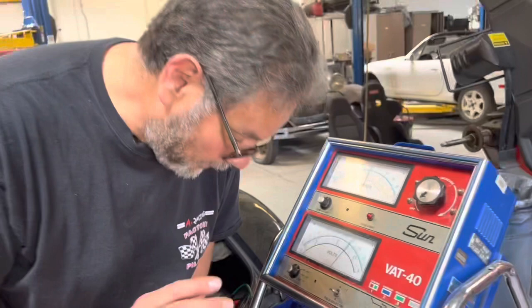Let's move on to the charging system test. Before I go into this test I want you to know what I'm looking for — I'm looking for voltage above static voltage. Static voltage is the voltage with the engine not running. Right now the car is not running and we have about 12 volts, so that's my static voltage. What I want to see is when the vehicle starts, that the voltage goes up to roughly 14.5 — anywhere between 13 and 15 volts is good. Anything more than 15 volts is overcharging the battery. Anything under 13 volts is not enough voltage. So we need two things: we need voltage and we need amps.